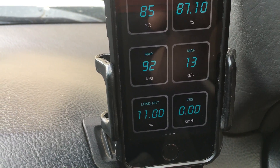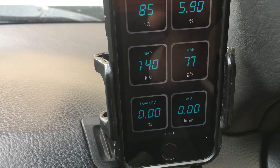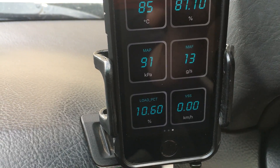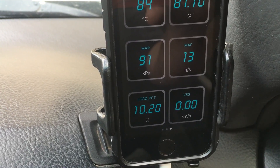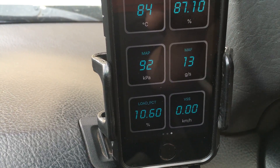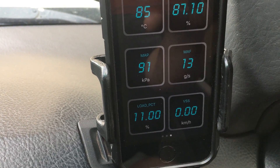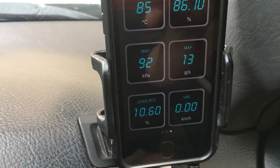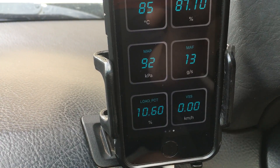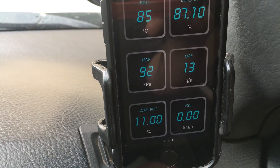Right there on 87% — did you notice it goes to 100% as well? Let's do it again: on the gas, off the gas — soon as we go off the gas, 100%, the EGR valve opens 100% so the boost pressure can dissipate, goes backwards through the EGR valve, backwards through the EGR cooler out the other way. We'll probably have more detail of that in another video, so subscribe and turn the bell on for when we do that explanation.